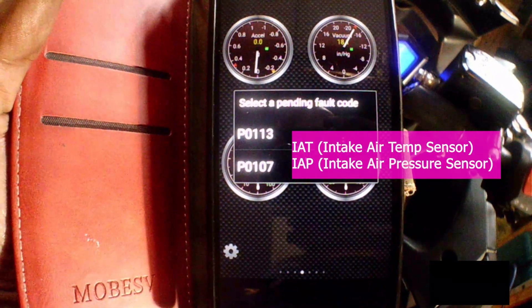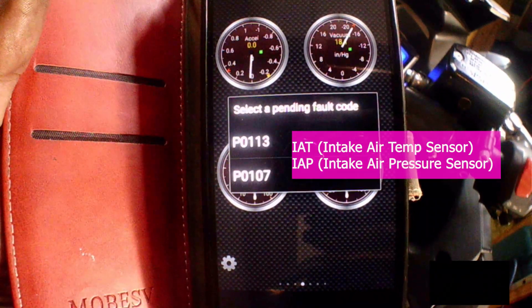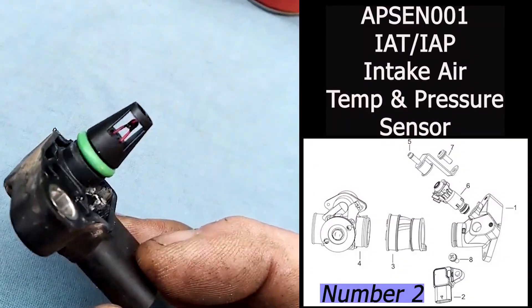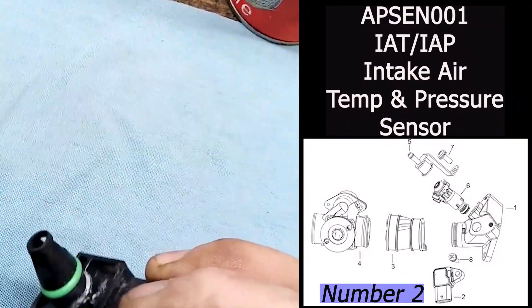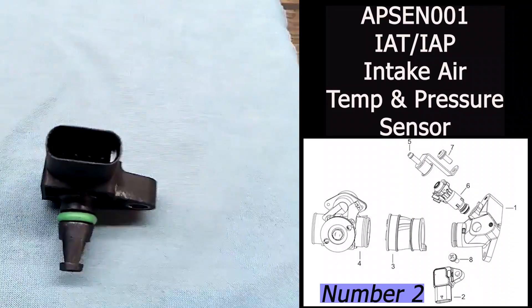It's the only realistic way of getting in there and doing proper diagnosis. There are plenty of faults that will stop this bike from running. In this case, the intake air temperature sensor and intake pressure sensor, which are one item combined — aside from giving this a clean, which I'll show you how to do later, and testing for the power cable, there are very few things you can do with this except replace it.